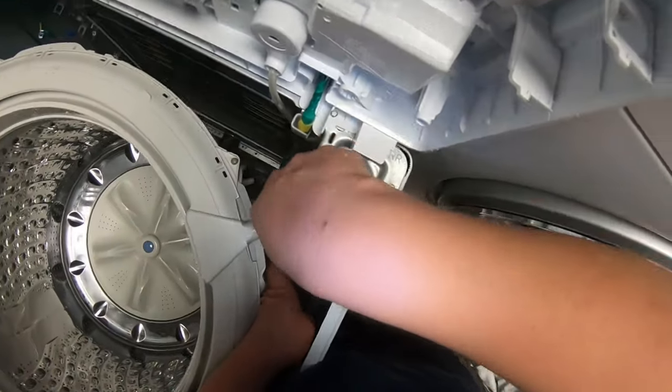Once you've got everything connected and verified everything is right, put the back panel back up — put the two tabs in the top first, then the two on the bottom slide back in place. Install the four screws to secure the back panel. Then secure the ground wires you removed earlier to have access to the top panel. There's another ground wire on the other side as well. Be careful with the connectors — they're kind of hard to get off, and if they break, just try to put them back the way they were.